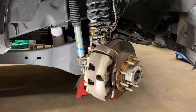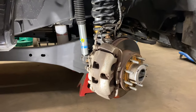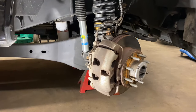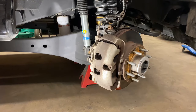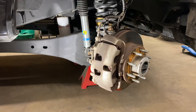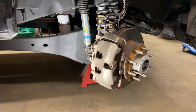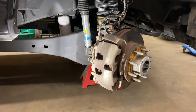I got the tires off. The truck's up on jack stands. For this, you can actually paint the calipers in place. If you've got a steady hand, you can get into all the nooks and crannies pretty good. It's brush-on, so there's not a lot of mess. I'm going to be cleaning these up really well before getting some paint done. Make sure you clean them really good — some brake cleaner, wire brushes, get everything off that's loose. It'll help you in the long run and you'll have a much better paint job in the end.